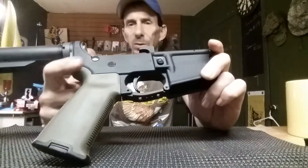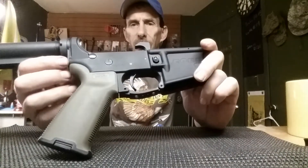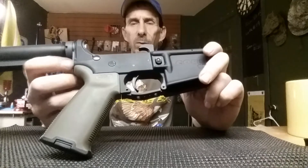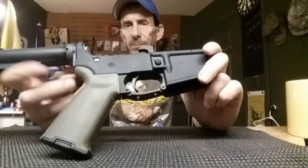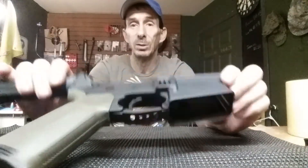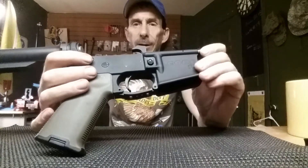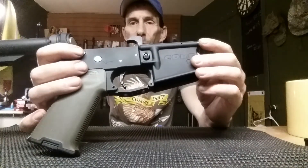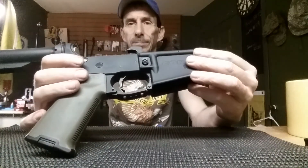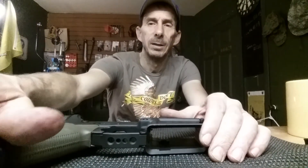But other than that, the back one is super simple. Just take the pressure off the castle nut, move this plate out of the way, and that little spring is right there. That's all I got for you — super simple, easy to do. That way you can put on fancy design pins if you want, or chrome ones or something you're wanting to stick in it. Thanks a lot for joining me guys. Take care, I'll see you next time.